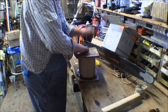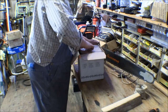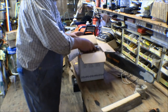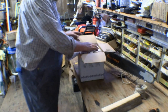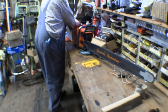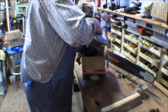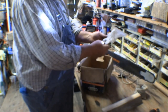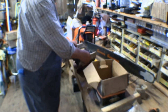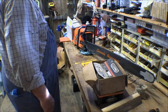I bought this chain material to make up chains to sell. I've got presets in there — the rivets for joining chain. The Stihl 3/8 I don't have presets for, but there are presets for this 404 chain in the box. I think what I'm going to do is go ahead and make up a chain out of this Oregon chain and file it for ripping. I'm going to go ahead and re-grind this chain.